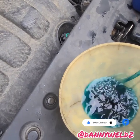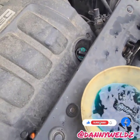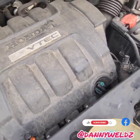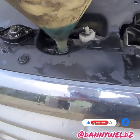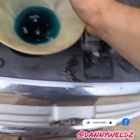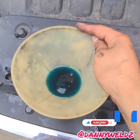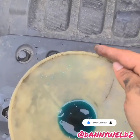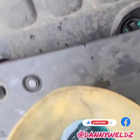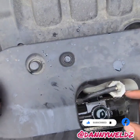One thing to watch out for is to constantly squeeze the hose over here just to make sure all the air bubbles are out. Keep the engine running at operating temperature and slowly put the coolant in there. As you can see, there are bubbles coming up — that's the air escaping from the cooling system. Once it gets low you refill it and keep watching for bubbles. Squeeze the hoses so more trapped air gets out, then close the cap.